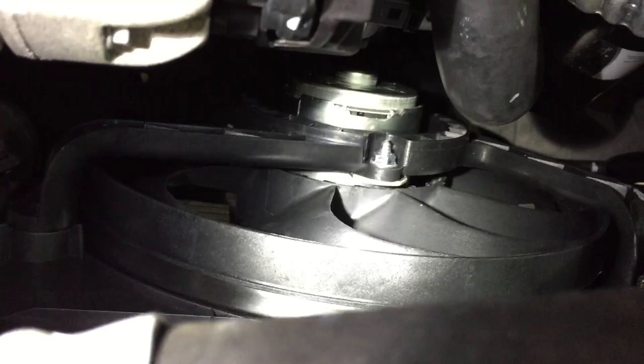There's the driver's side fan. I've got the new one installed and it's already in place. While we're up here — there's one of the top mounting screws there, there's one there, there's one there, and this one's the tricky one right here by the upper radiator hose. That's where I use that short, small ratchet to get in there.